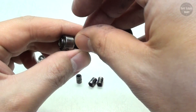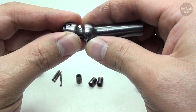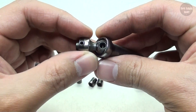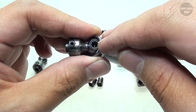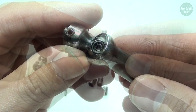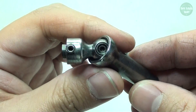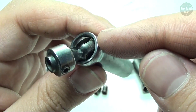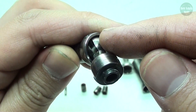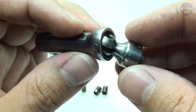So now I'm just going to slide this right down the middle, make sure it comes out the other side, and then I'm going to move this to the side and insert a grub screw right there — it's going to hold that pin in place. With that grub screw in there, this whole thing is not going to be falling apart. However, I am going to have to get some grease and grease this entire joint. That is required for the MIP drive shafts.